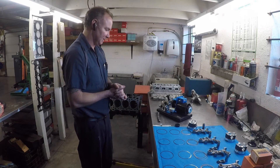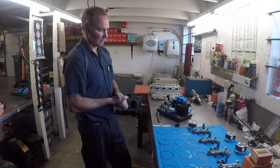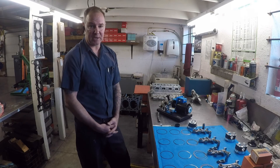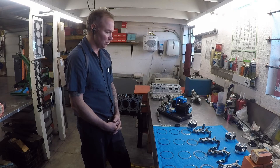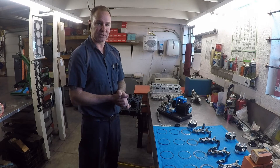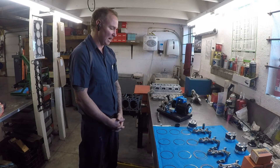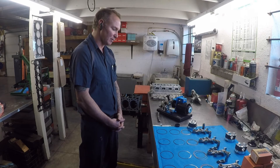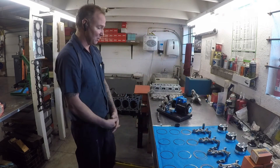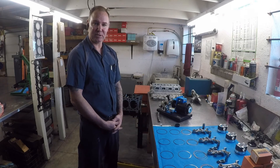This is a really important part of building a proper racing engine. A lot of people think building engines is easy work, but it's very meticulous. Doing things properly like this is what makes these engines last a long time, make good power, and prevent blow-by. Most of these are limited-prep engines — this motor is only allowed 10-to-1 compression — so we can't afford to waste static compression through blow-by past rings, valves, and things of that nature. Kind of like being a surgeon: you have to make sure everything's done properly.